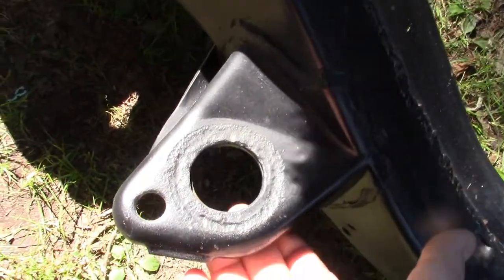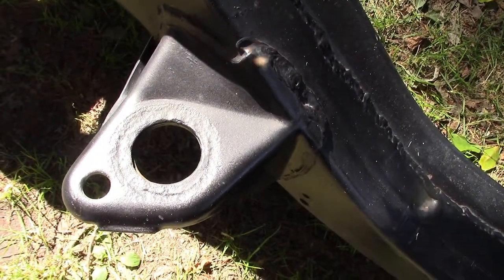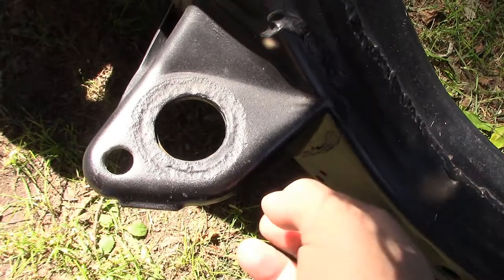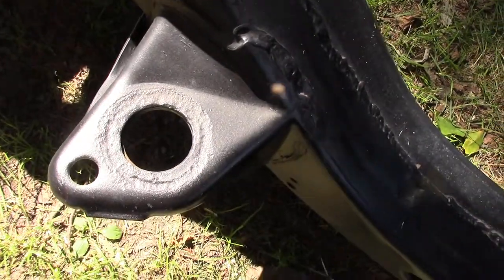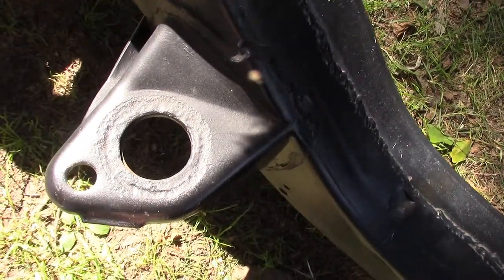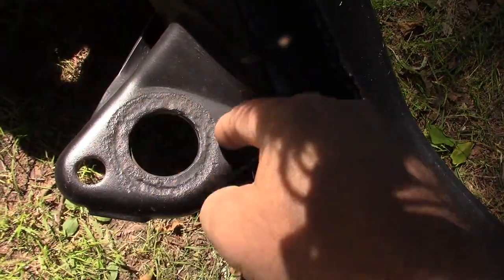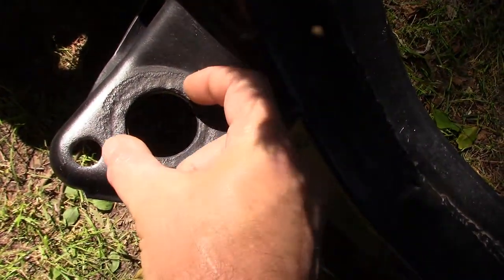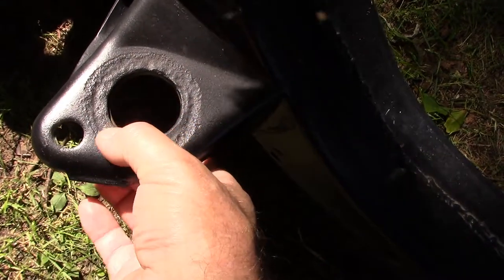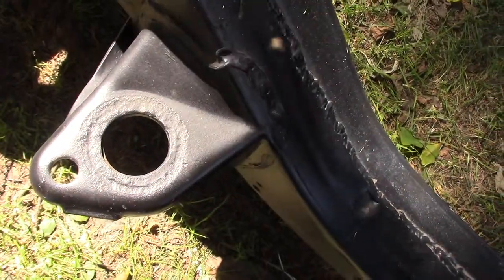I made some plates and put them down in there, but they're a little too thick — don't overthink it thinking you're building a tank because you're not. What I should have done was clamp those pieces in with some vice grips, cut that out with a hole saw, take the upper frame layer out, move the other one up, and weld it in — I would have been a lot better off. Now it's just a little thicker than I'd like to see, so I might change that too.